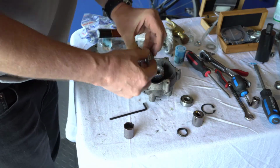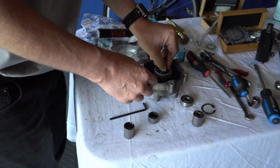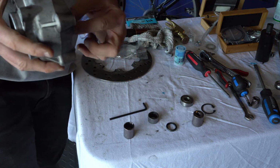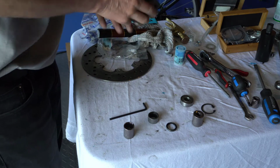And you want to get it down far enough that you're able to put this seal on. It just snaps in by your finger, it sits on top, and it's a grease seal. There's nowhere for it to go because it goes on a shaft that, if you look at it, the diameter gets a little bit bigger towards the end, so it can't really move that way once this is on.